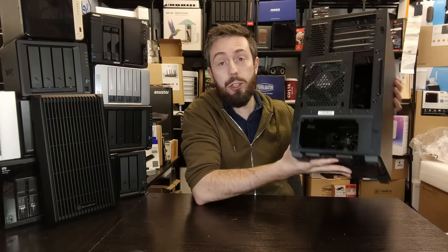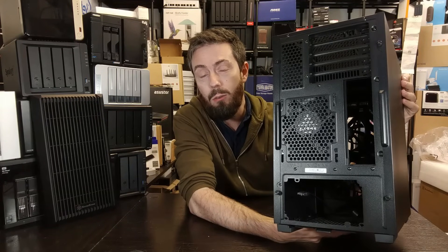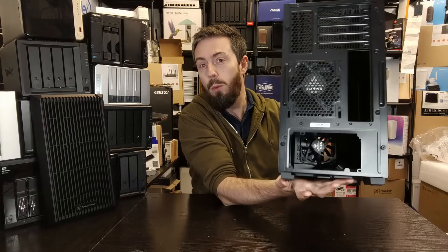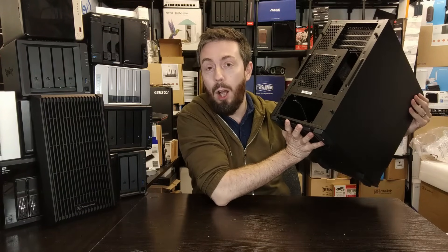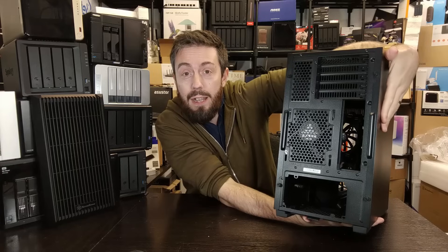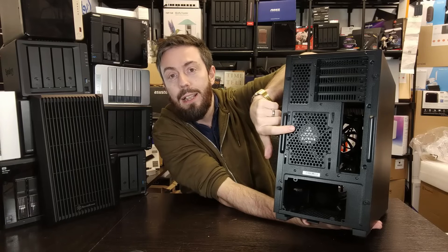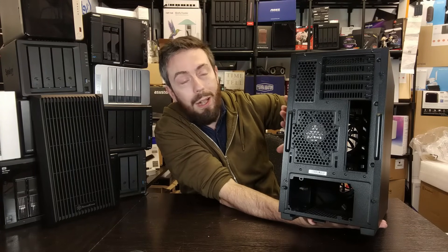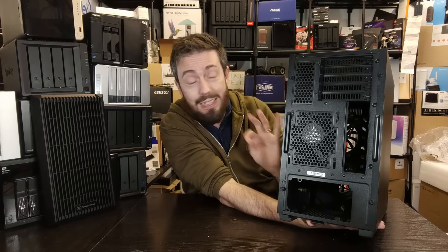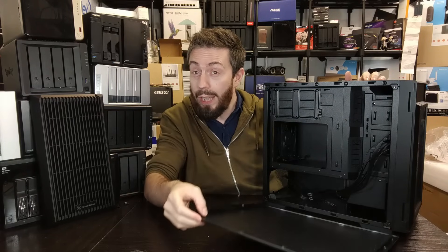On the rear there's also an additional fan in the middle — probably not as noisy as the two rear-mounted drive fans, but still a third fan in a metal chassis, so noise is a consideration. There's also the cavity at the bottom for the ATX PSU, and a side-mounted motherboard slot on the side with no ventilation on that panel — which is surprising. However, since the rear fan aligns directly with the 168mm max-height CPU cooler, that should be fine. They really have maxed out ventilation throughout this case in impressive ways.